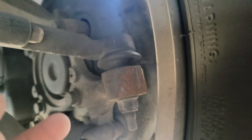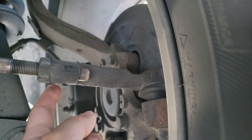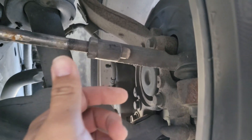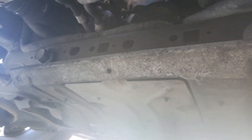In order to get this rack and pinion out, you're gonna need to pop this off from the knuckle. You're gonna have to turn the tie rod - count how many times it comes out - because when you put it back in you have to put the same number of threads back. There are two bolts holding the rack and pinion aside from those two body bolts, and there are also two connectors - one for power and one for data.